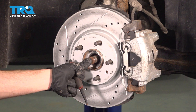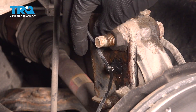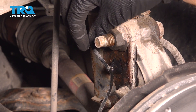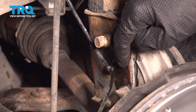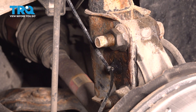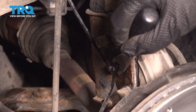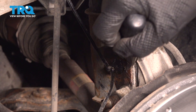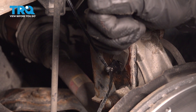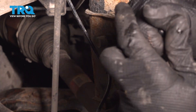Once you can see movement from this area, we'll continue on to our ABS wire. We're going to have to dislodge it from three separate areas. We'll start down here where the strut connects to your front knuckle. I'm just going to use a trim tool as a prying device. We'll make our way in between the plastic clip and try to separate it from the front strut. It's common for these to break — you could use some penetrant. Just try to work it out of there.